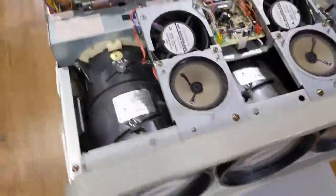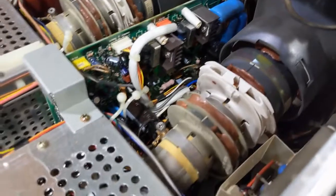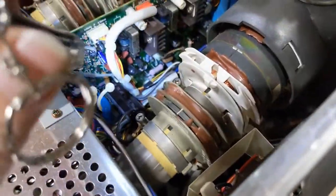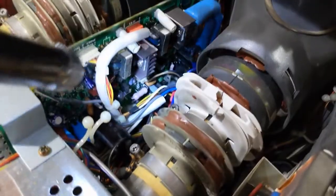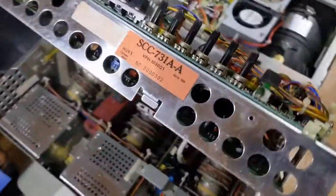The optics probably need cleaning too because it's old enough to where that is likely going to be a problem. Let's take a look at the other side — I've got to constantly get up and walk around because this thing is so big. That definitely looks like the power supply. Let's shed some light on the situation. I'm not seeing anything obvious — I'd have to pull it. I don't have a functional flashlight anymore. That's the flyback — it's the deflection board.